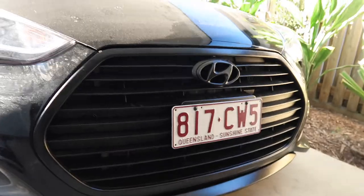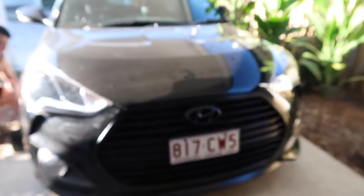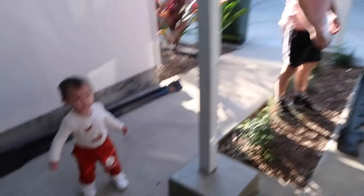The spray feels like it's running out, but here's an update — after coating it twice and spraying it with the clear hardened seal, I sprayed one coat, let it dry, did two coats, then let it dry in the sun, then installed it. So outside right now — it's pretty much blacked out. If you look closely it's not perfect, but do I care? No. As long as it's blacked out it looks great — no one's really going to get that close to your car.